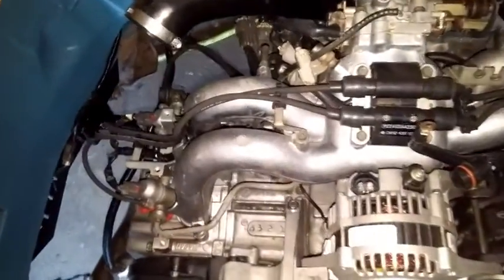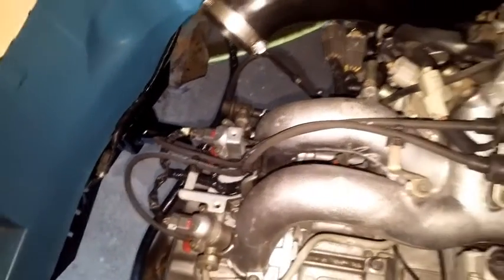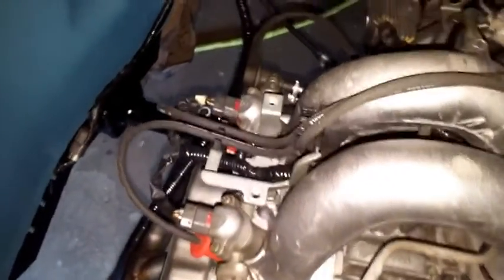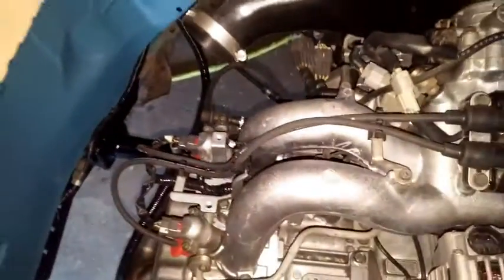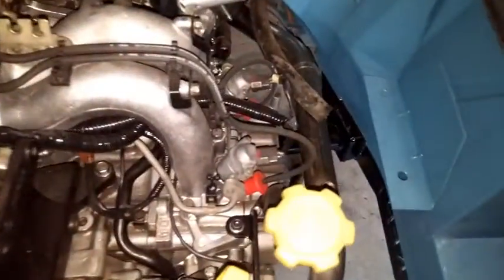And then the biggest part of it is the fitting of the engine, because they do not make an engine carrier for a diesel specifically. We've had to modify the existing one that they have, in which we made these boxes that act as spacers and moved the bar to be able to fit it. That of course has to be precise work, because you want the best joints possible for the needed strength for carrying the engine.